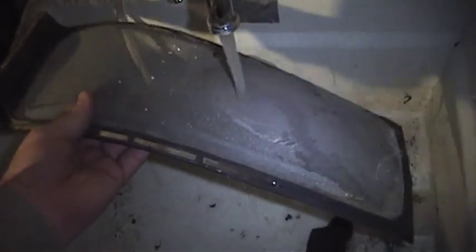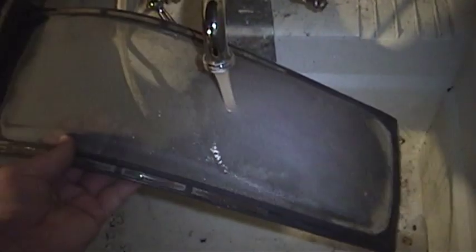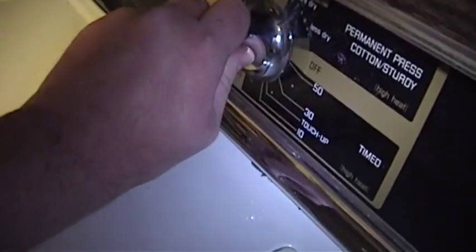And here's another good idea in regards to dryer care: keep the lint filter clean. This one's pretty bad - I can't actually get that lint to come off there by hand. Okay, here we go for a test run. We'll just put it on about medium dry, hit the start button. And in a matter of seconds, that coil should start getting hot - it should glow visibly red. Oh yeah, I smell it heating up. Definitely smell the coating burning off of it. Hopefully nothing else is burning. But it's definitely blowing warm air.